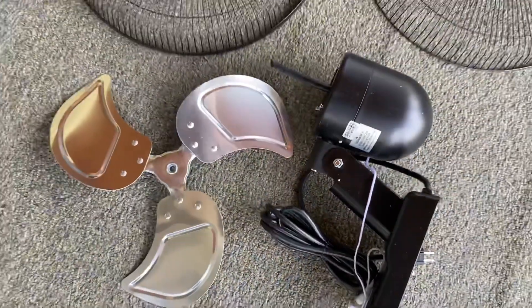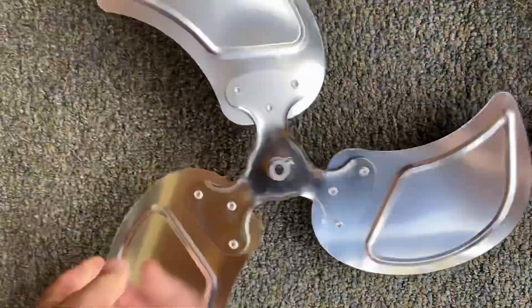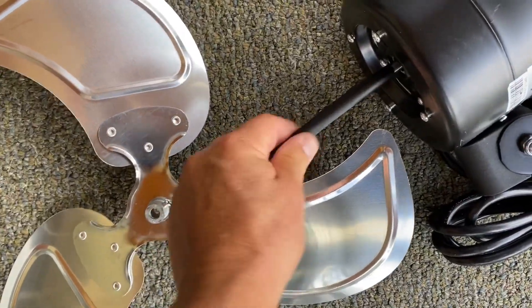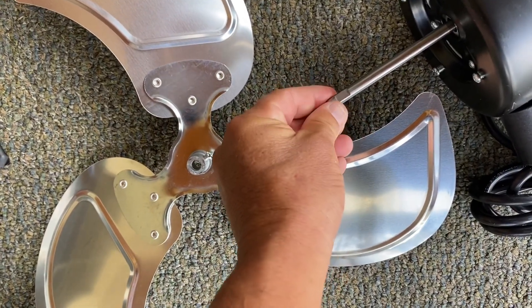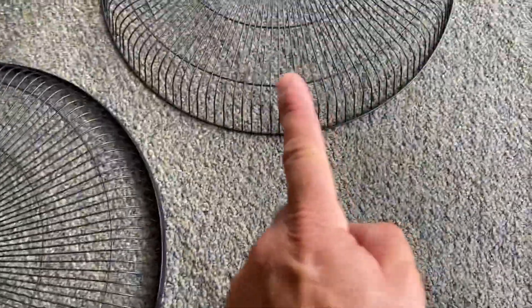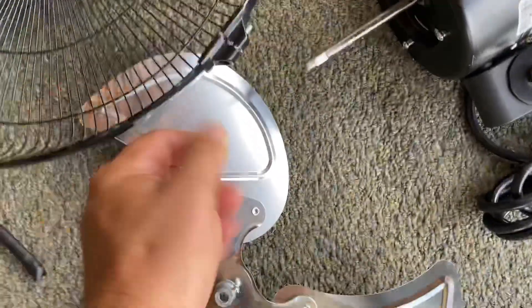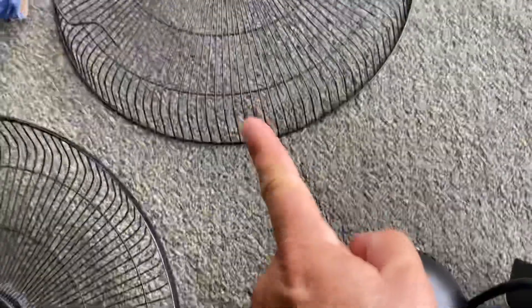It's super simple to install. One little trick: there's a set screw on the back of the fan blade. When you take this off — it's just for shipping — you pull that off, slide it on, and you'll notice a little indentation right there. That's where you want your screw to line up, then tighten it down with a Phillips screwdriver. Put your back plate on first — it mounts on these four screws, and you can see where there are four slots. Then your cover is very simple: loosen it with the bottom screw, slide it over the back plate, and tighten it.